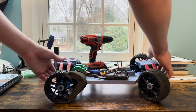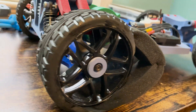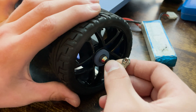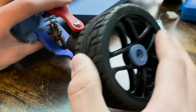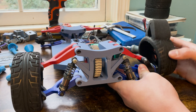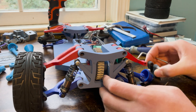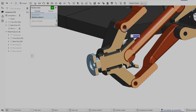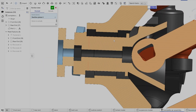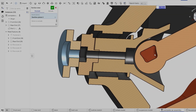Picking up now where I left off a month ago, the car's looking rough. In the crash, I not only blew up the wheel, but both axles, the drive axle, the U-joint couplers, and I chipped the suspension brace as well as a few other things. This was pretty unfortunate, but it is what it is. The first thing to do before I can start with this mess is taking everything apart. As far as new parts, I decided to redesign the rear knuckles to have more structural rigidity. In the past, an issue I really didn't love was that when tightening the bolt that attaches the knuckle to the A-arm, it pinches it and binds it up.